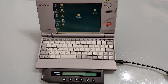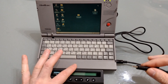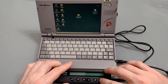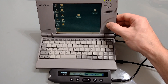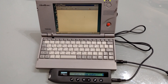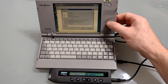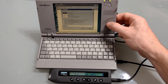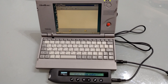I've already connected the peripheral hub and connected the serial cable to the back of the Libretto. To connect it up we need to first plug the jack into the pen reader, turn it on, and then start the software program. The first time you start the program you need to tell it which COM port you're using — you do this by going to Tools, Configuration. You also need to set the correct language. Once that's done, hit OK and it should connect and transfer.